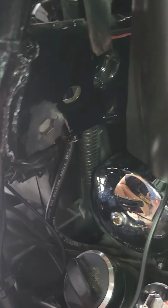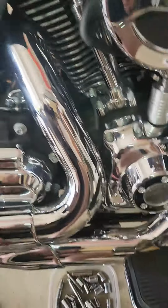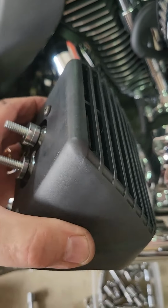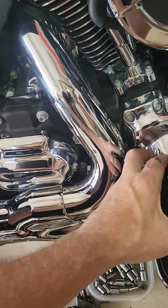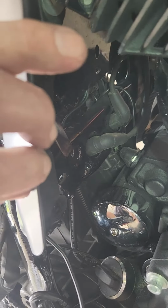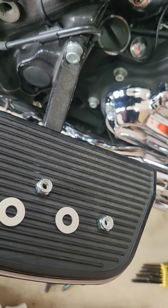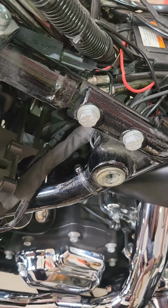Okay folks, so I've got that touched up in a different color. I'm not going to tell anybody. So this fan has a couple spacers on it. Just wanted to show you this. You can see you've got two spacers that go on what they call the inboard or inside portion, and then one that goes on the outside. And the idea here is that this outboard one, this one here, is actually going to hold that deflector on where I punched that thing out. It's going to slip in those two holes, and then back here, towards the battery compartment, if you can see those holes, that's where they're going. We're going to put a couple washers and a couple of these 11mm, looks like they're locking nuts, and we'll go ahead and cinch that thing up there, and that'll be the position of it. And then we just have to figure out how we're going to wire it up. All right, I'll be back.